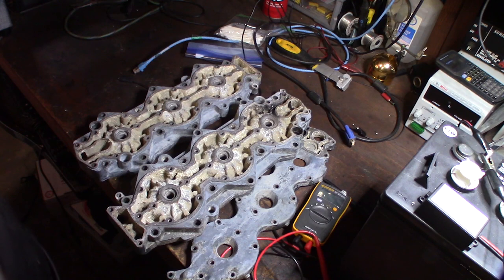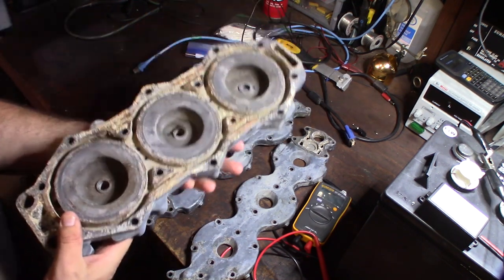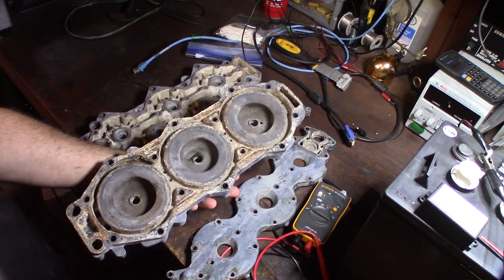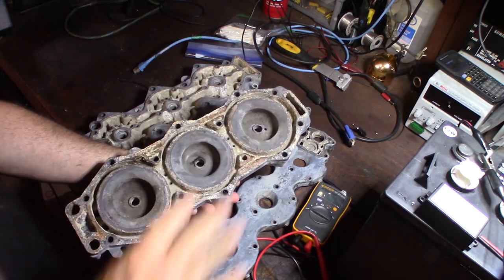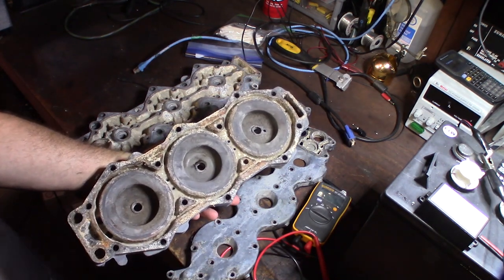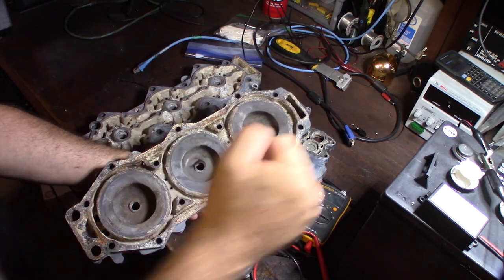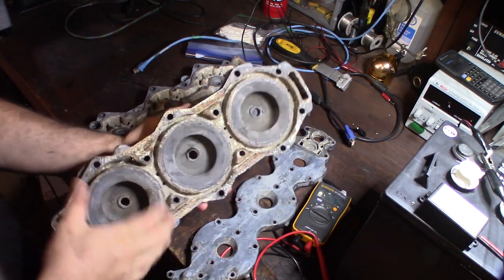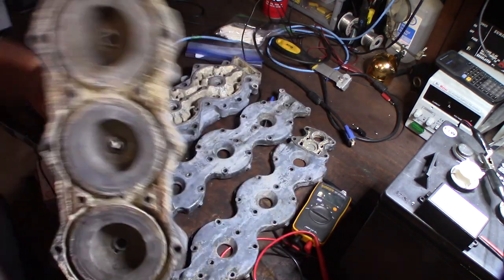We took the heads off, and there was water in the cylinder, and it was rusted. It was seized, the cylinder was rusted shut. It was just totally locked up. So I was able to Brillo pad the cylinder. I'll show you that when the engine gets back up here. We were able to get the rust off, and I was able to unseize the engine. But at first I thought it was just a bad head gasket. That was a problem.